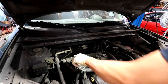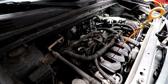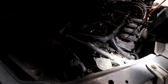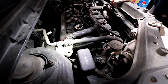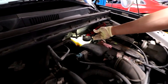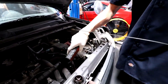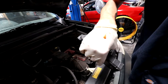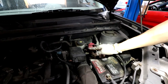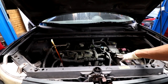Come under the hood, pop the oil filler cap, pull the dipstick — these remind you later to put oil in. Then do the inspection: top off the windshield washer fluid, check the drive belt for cracking, check the timing cover and valve cover for leaks, power steering pump, look for anything out of the ordinary — cracked hoses, anything like that. Always check the brake fluid reservoir; if it's dirty, you can recommend a brake flush — a nice little upsell. If the car has a transmission dipstick, check the fluid level. If it's dirty, recommend that too. If we were at Toyota, we'd run the battery tester while finishing up the inspection.